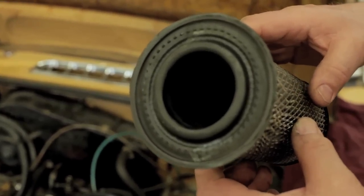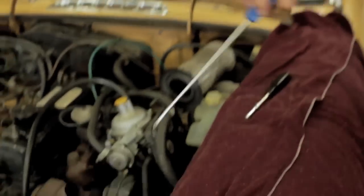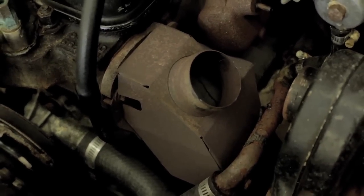The reason there's so much soot on there is because there's a crack in the manifold. I will point that crack out as best as I can, but I don't want to use the light because that always screws things up. Here we've got this massive crack, and by the position of this crack, I know that when I take this manifold off the car it's going to fall into two pieces. Not only does it give you a whole lot of soot underneath the bonnet that the air filter picks up and clogs up and causes the car to run rich, it also makes a real great roaring sound.